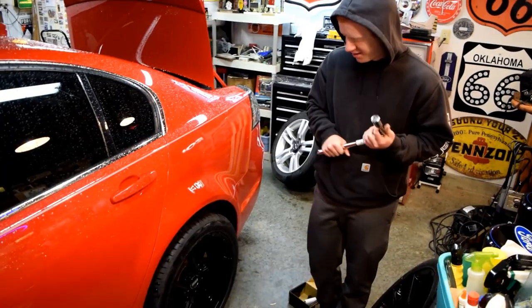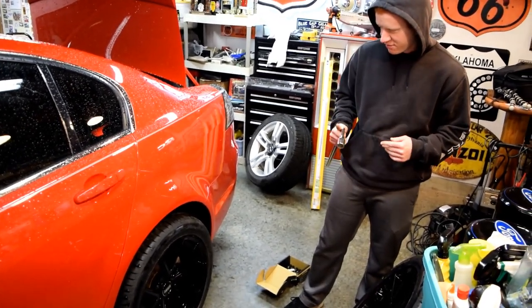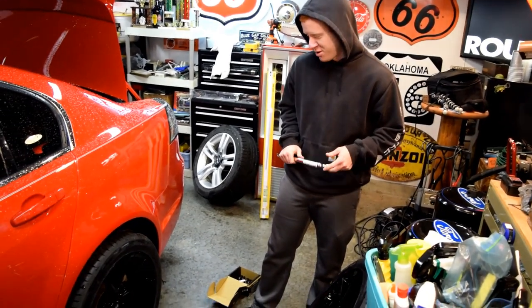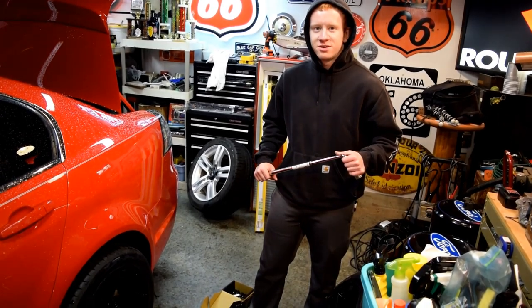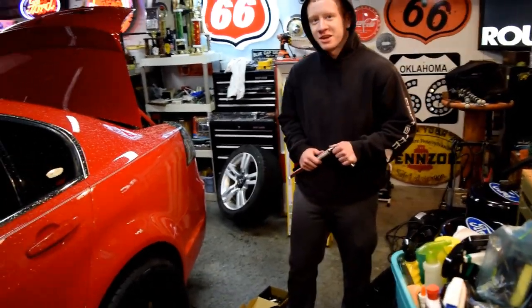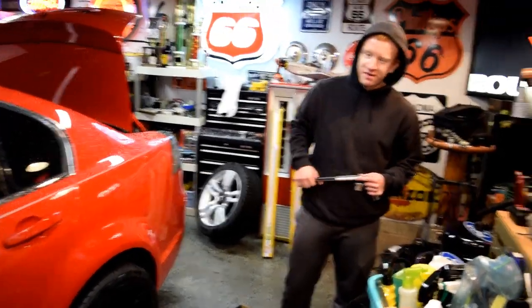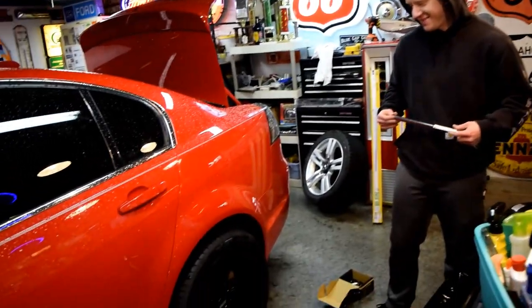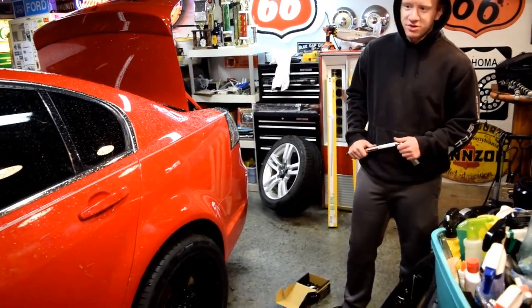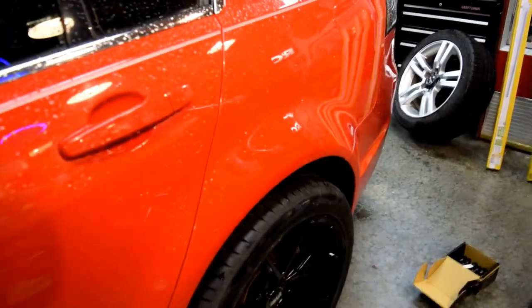So let me get Lucas and tell you what these guys are. Okay, these are the BMR V804s, finished in gloss black. For the new tires, since the old ones were pretty bald, we put Hankook Ventus V12 evo 2s. 275 in the rear, 245 in the front, 40 sidewall. Hell yeah. When the car moves, it usually drops a little bit, and Lucas doesn't plan on being at stock height forever either.